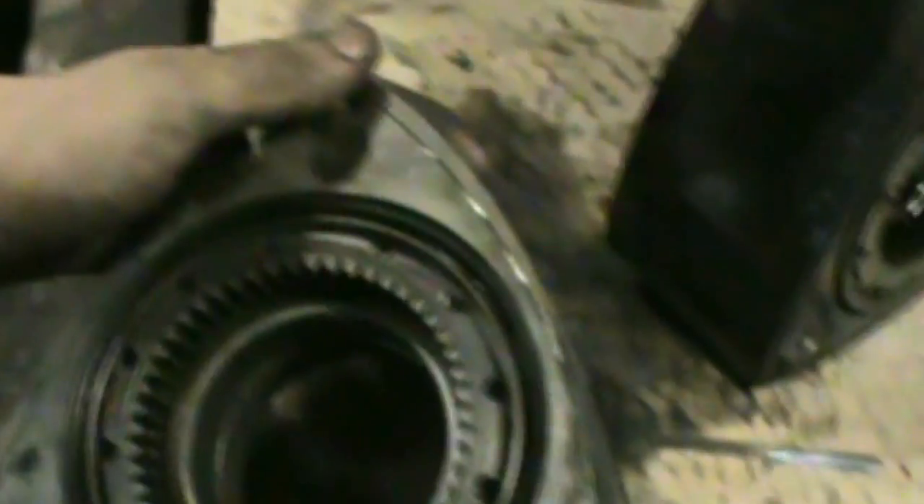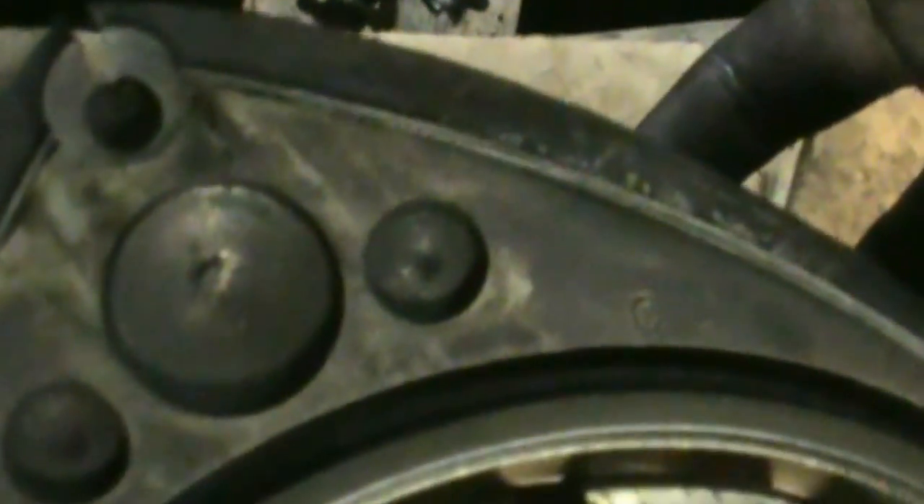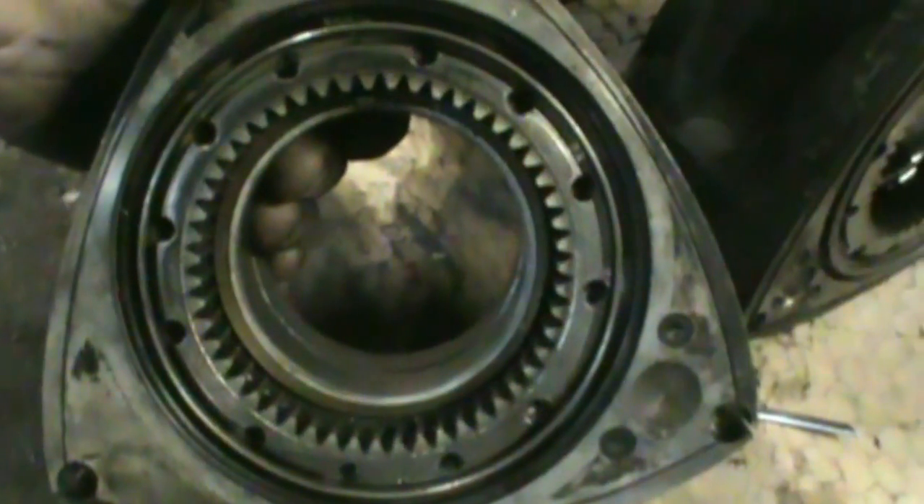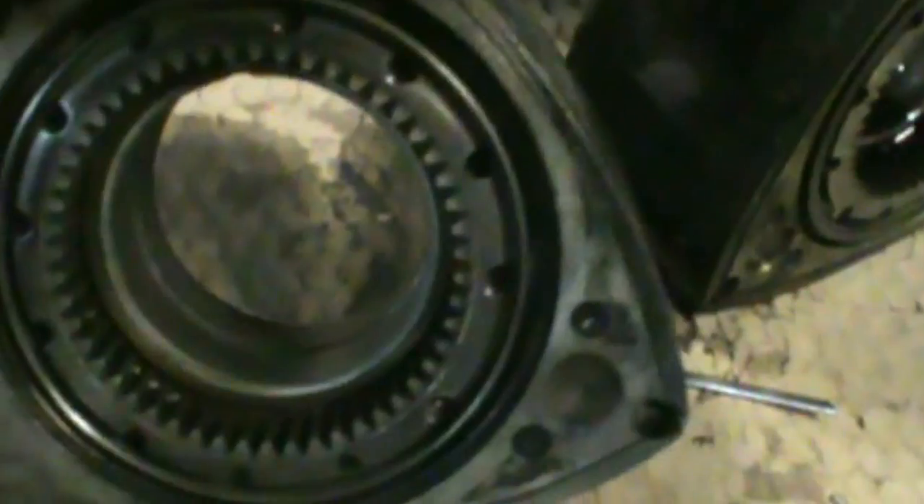Now that the irons are all pretty much ready to go, I'm going to move on to the rotor. Luckily it had a C weight — you can see they have the C stamped into it there, so it's the same weight as the others. You can pretty much go one size up or one size down; like I could use a D or I could use a B rotor with these ones. So it's not too bad.